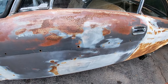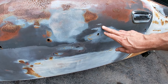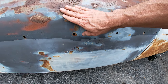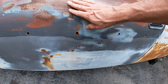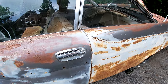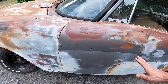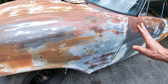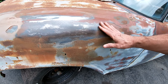And you can see here, I didn't touch this car yet other than that fender, and all these DA marks. So this wasn't me, and he did this down to the metal and that's why it rusted — so it's all swirled and rusted and pitted. This car is not small. I thought it was just a patchwork — he sprayed some red primer and then he sprayed some gray primer when he ran out. But apparently he was just spraying primer, sanding, primer, sanding, primer, sanding, down to metal, not down to metal.